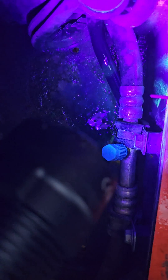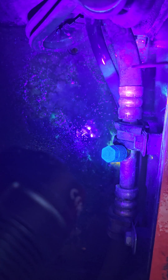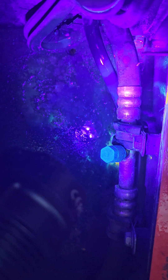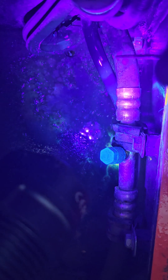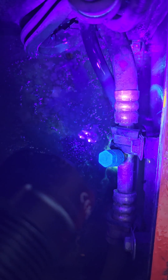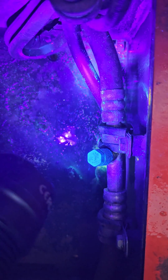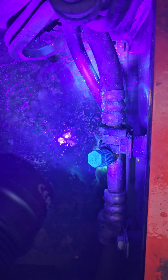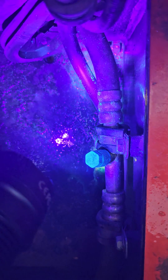It'll bubble through with the brake clean. It keeps coming back right there. But if I wipe it with a towel, it disappears and it doesn't come back. Super crazy. I needed the brake clean on the hose to saturate it — so it's slowly leaking out right there.